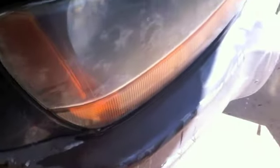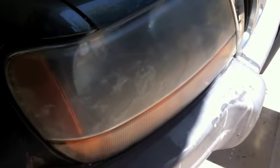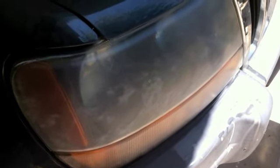And that's the results of the 1000 grit sandpaper. And you'll begin to see also now with your eyeball the different places here which require some extra work. You've kind of exposed the areas which are a little higher in oxidation and wear and tear on the headlamp. You can see where you need to put some more elbow grease. Now it's going to take a few minutes, going to take some patience, but the result is going to be good. So let's keep up the good work.